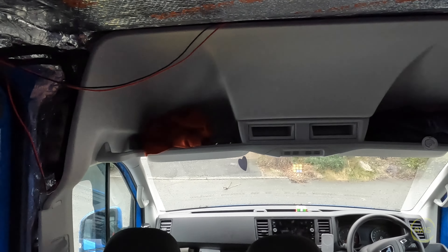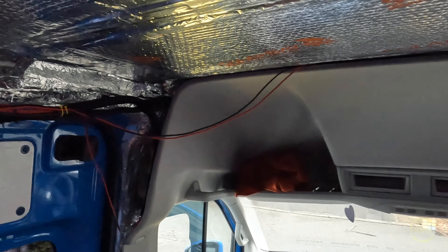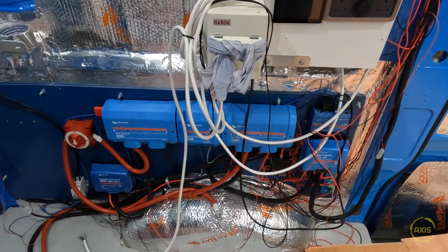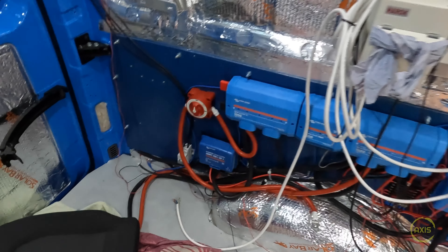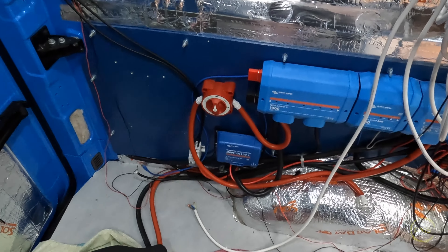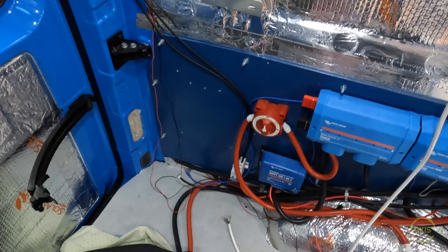So I think we're looking to do a lot of that. As you can see, quite a lot of cables - they've actually done some stuff. At the back here it's a Victron setup. I've just been going through all this now, seeing what components are missing and what wiring needs sorting out. There's a Multi-Plus on this side for the AC side of it, for the plugs in the van - all that needs rewiring and rechecking. There's a solar isolator there, which I'm not sure I like - I'll probably change that one.